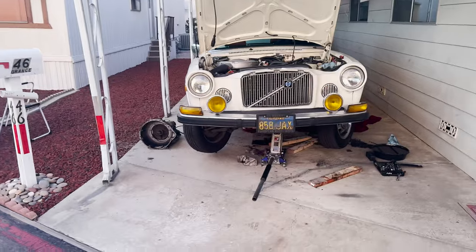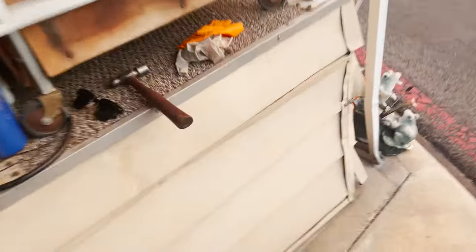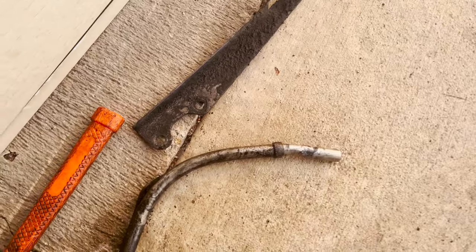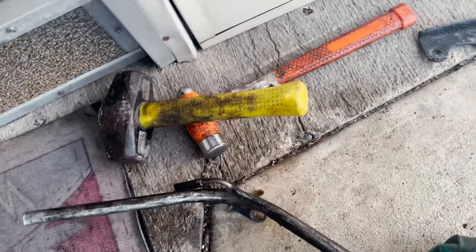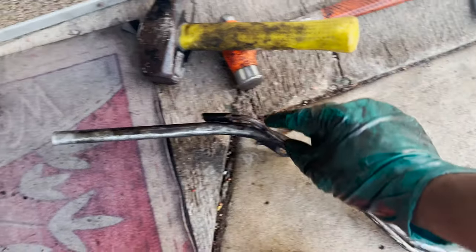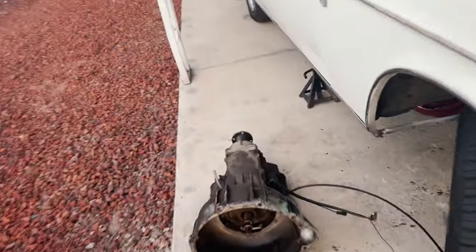The end result. It was pretty awful. Mostly because I didn't remove the dipstick tube. The dipstick tube has a lot that goes into the trans. That's a good 2.5-3 inches, and you can see the drama from trying to bend it. And then there's also this vacuum line, sort of. It's like a vent hose. I think that's to prevent burps when you're filling it.